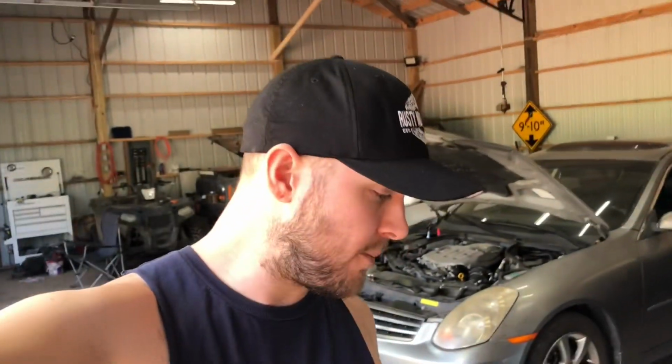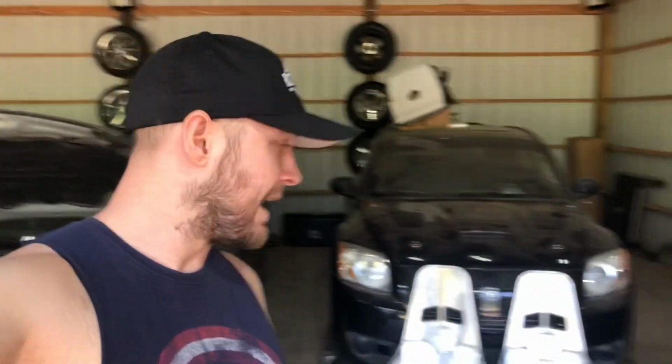To be quite honest, I don't know how to do this. As far as I know, they don't make aftermarket frame rails or sliders for the Dodge Caliber. So, what we're going to be doing is taking the frame rails off of the stock seats and trying to modify those with our brackets to the Kirkey seats. It's probably going to be a bit of a mess as we go along, but we're going to figure it out. We're going to get those seats mounted in today.